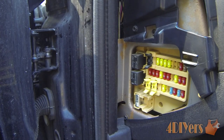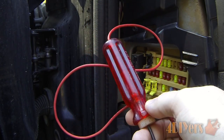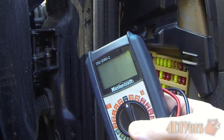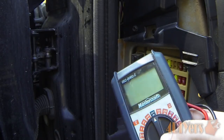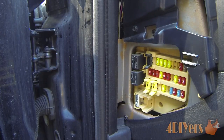For testing these circuits there are a couple of different methods, and I'll be showing you both. You can use a test light, which is fairly inexpensive and easy to come across, or you can use a multimeter on the voltage setting to determine that there is power in the circuit. You don't want to use a resistance test while the fuse is in the vehicle, because this can send a small amount of voltage through the system and risk damaging the electronics.